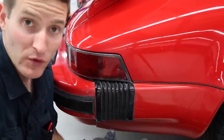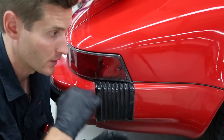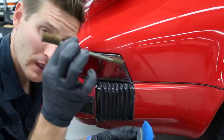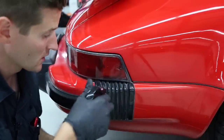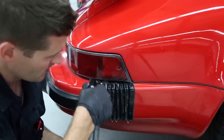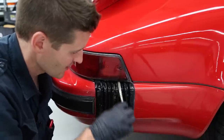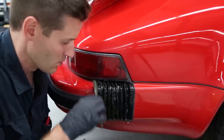The rest of the car looks good — all I need to do is wax it, that'll be the last step. Now I'm going to play with the trim. Typically I do the trim at the beginning while washing, cleaning, and claying, but this one was so bad I wanted to focus on it at the end. I have my two tools: a double-ended toothbrush and a very stiff-bristled brush. I use all-purpose cleaner, soak it in there, let it drip, get into all these fins, and while it's dripping go in with my brush — really get in there and gouge everything to scrape out and remove all the gunk.